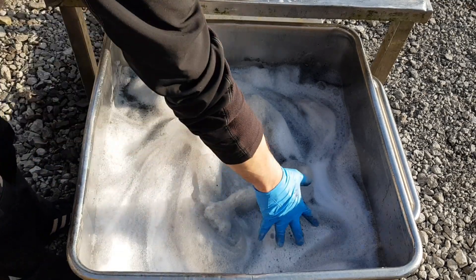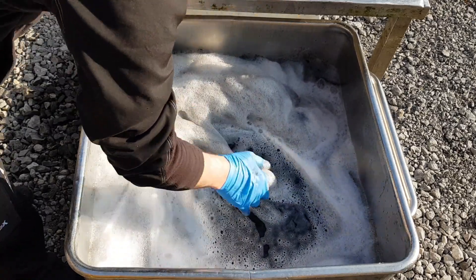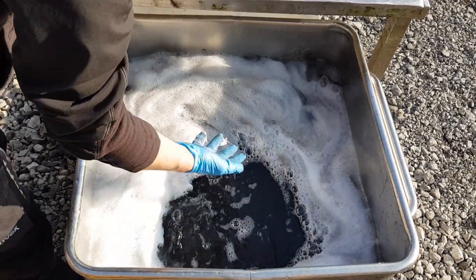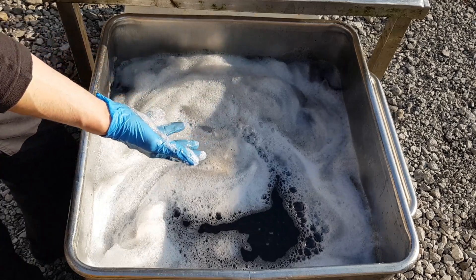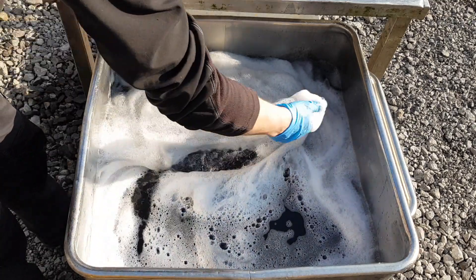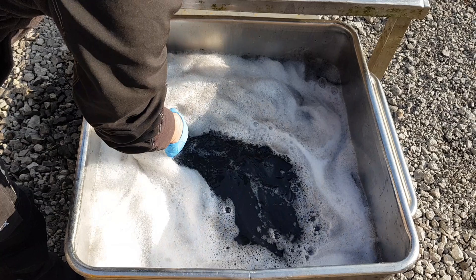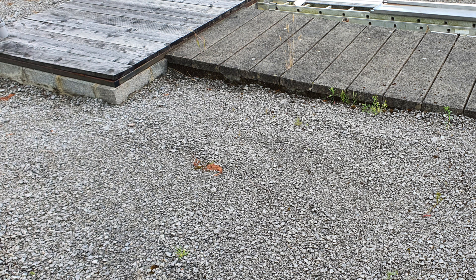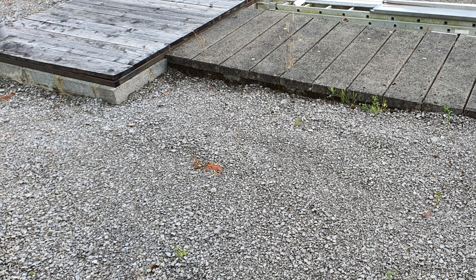The foam is obviously cleaning off. It's still kind of grey and white, but this is nearly 200 liters of water and it's pure black — so you can imagine all that stuff was inside. This is just an early stage of the cleaning process. That just shows you how much soot, ash, oil, and unburnt fuel and captured particles are all in your DPF. For disposing of the waste, I use my three-stage septic tank — I just dump it in and don't have to worry about any environmental issues.